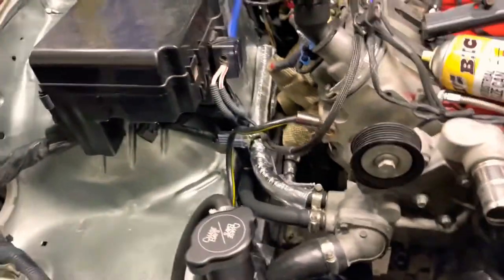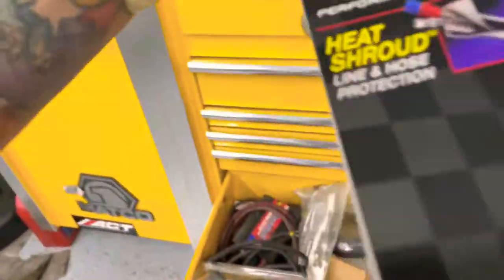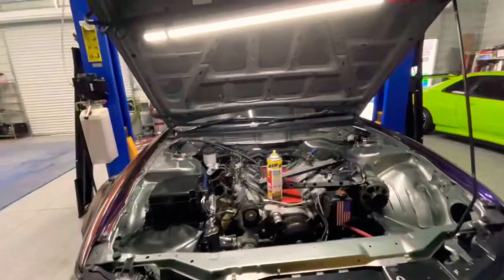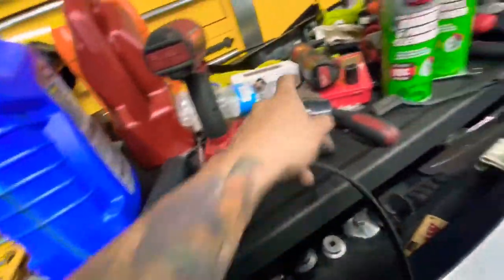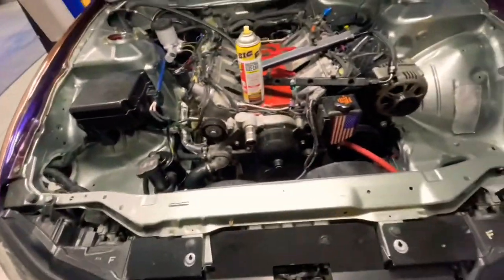I already ran the hoses from there going down this way. I ran the heater hoses all the way there and put double wrap of heat shroud around the hoses because they're next to the headers — so double the tape of that heat protection material from AutoZone. I bought a hose from AutoZone and cut it up to make it fit, so now we're not going to have any leaks down there. Everything's secure — every hose is the size it should be. Now I'm going to install the belt, the top hose, and the manifold, and get this thing all wrapped up.